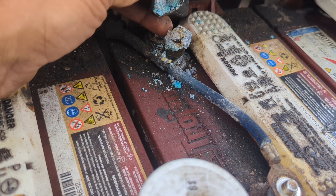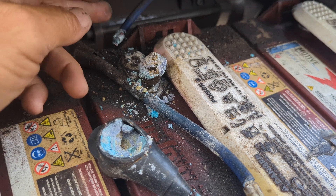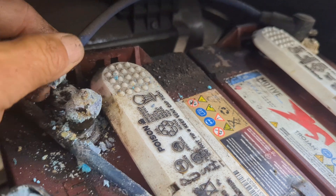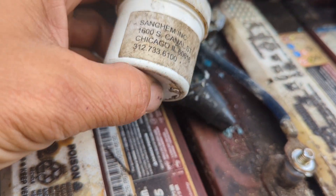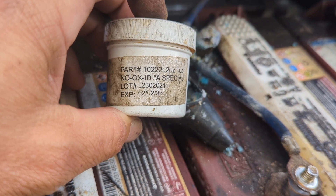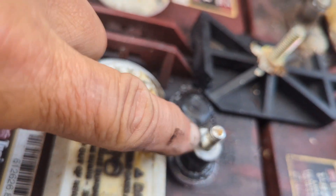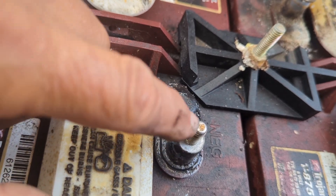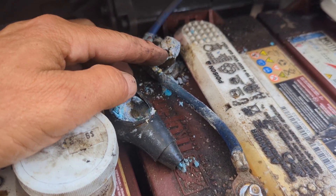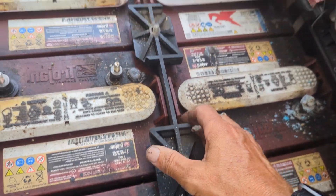Moving into this cart, taking the cables off, you find a terminal cover, and when you try to remove it you can see where the corrosion has completely destroyed the cable lug. This cable has not been connected — I'm not even sure how the cart was able to back up. This jumper from negative to positive will be replaced. I wanted to show you this chemical — I believe it's on Amazon — I love this stuff. By simply applying this jelly to the cable ends and to the terminal threads, base, and cable ends, it'll slow down if not prevent this kind of growth and decay, and your cables will last longer.